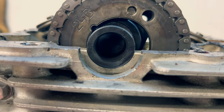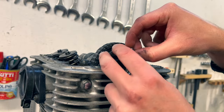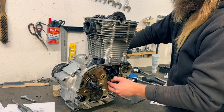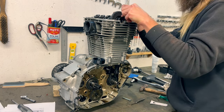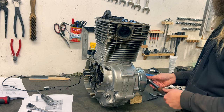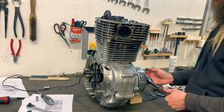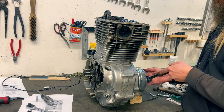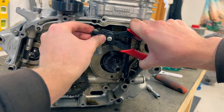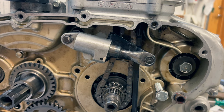Another super important thing right now is making sure you are at TDC. I have no real trick to this — just loads of trial and error will get you there. And remember to check your work like a hundred times. Here we can see that the new chain is not touching itself and we have plenty left on the adjuster arm.